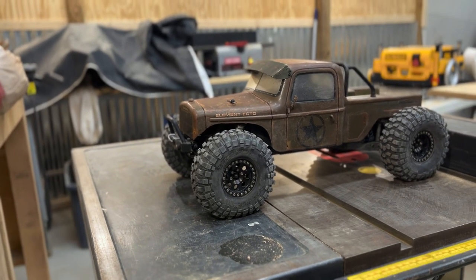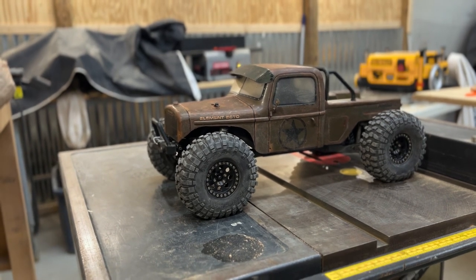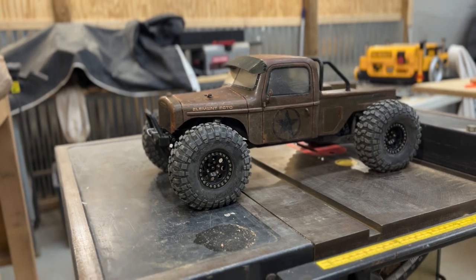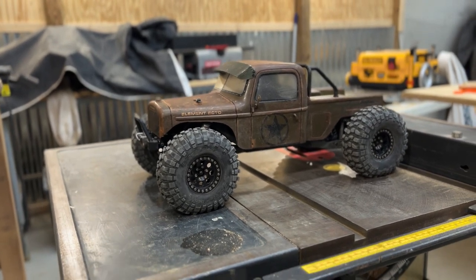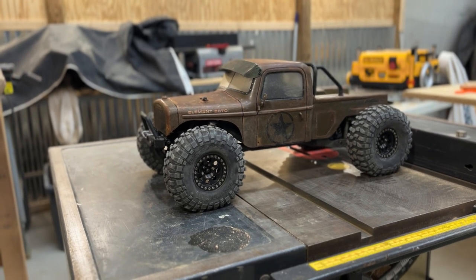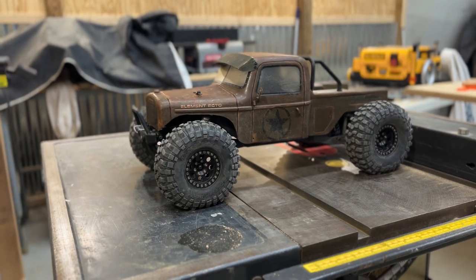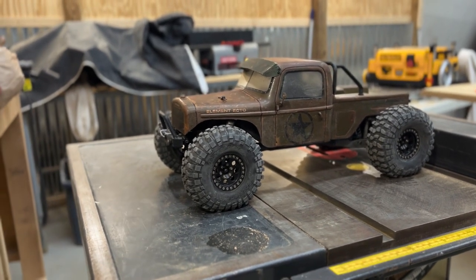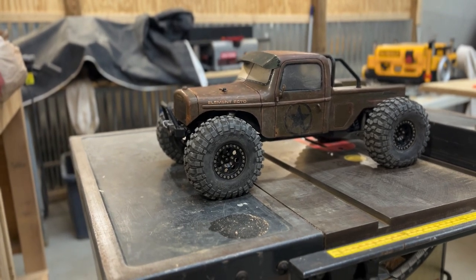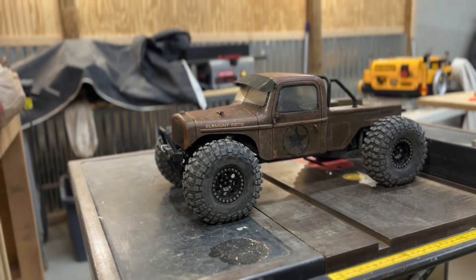Well, apparently when I hooked up the Castle Link, somehow it took away my throttle curve for reverse. So it was set back to the factory linear setting. And that really screwed me over in several spots, because I'm used to having a nice soft throttle curve, and every time I went to just barely touch the throttle in reverse, it was just hammer time.